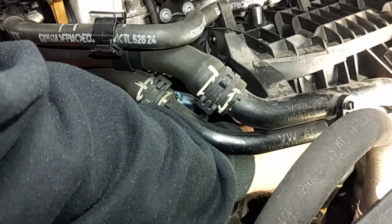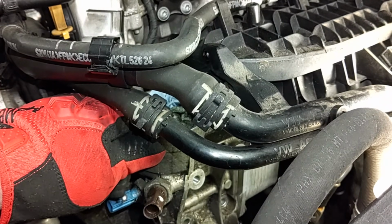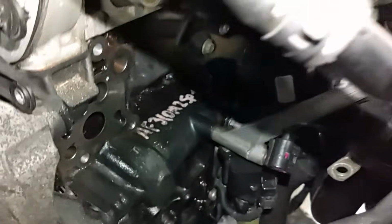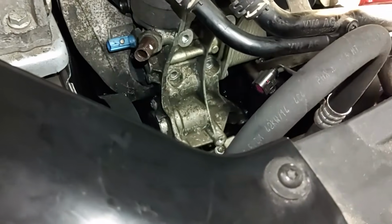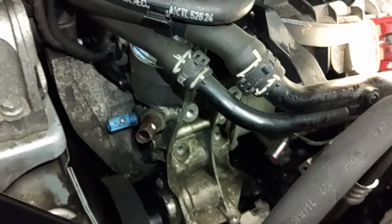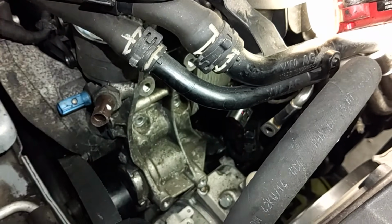Okay, what I did was stuck my hand down through this way and felt the union lined up with the water pump hole there, and now that I'm lined up, I'm ready to apply some force here and pop it into place. Okay, I decided to try a different approach here. I took the union out, stuck it in the water pump there, and I'm going to try to bring this assembly back up and try to do it that way. Okay, I finally got the housing in position. I got one bolt started in by hand up top just to secure it there, but that was the worst part of this whole thing, trying to get that lined up. But I got it. It took multiple attempts, but the best way for me was to put that union in the plastic water pump housing first, and then line the oil cooler up with it, and then push it into place. So it worked out.